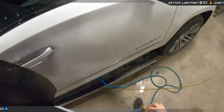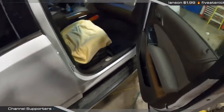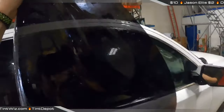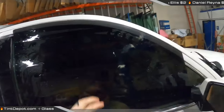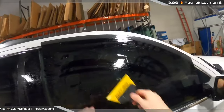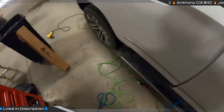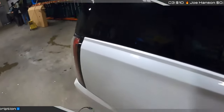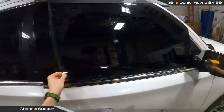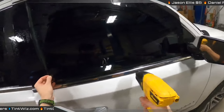And then I found out that if you take one of these plastic scraper cards, like the Gator Blade, that will actually be good enough for the majority of windows. Either that or just wiping them with your hand. I like to dig out the seals a little bit though. Is a plastic razor any good? It's not gonna be as good as a steel razor blade. So if you have a sticker or something, like you'll see, there's the staple OnStar Wi-Fi sticker on these. So I will take a 1-inch razor blade for that portion. And because I have it out, I'll often use it on the rest of it.